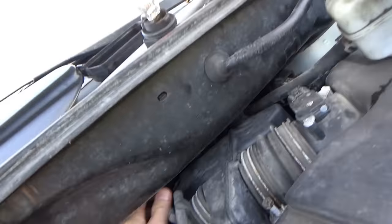Now where does that come from? Is it from here? Is it that bolt? Let me take this fender liner out, do a quick visual, see what the heck is going on there, because I don't think that's factory. Wow, that is a sharp screw. So I took it out, now there's a hole in the fender, which shouldn't be there to begin with, and right next door is a nice plastic little place where the bolt should have gone. So that's where they had the aftermarket one screwed in.